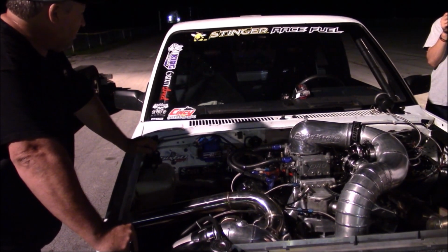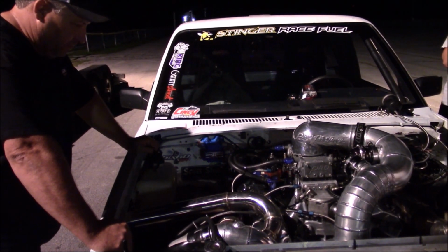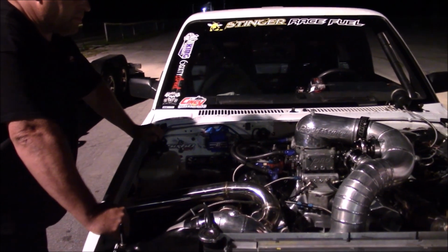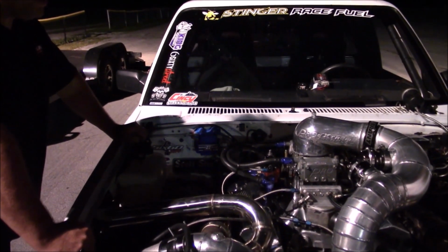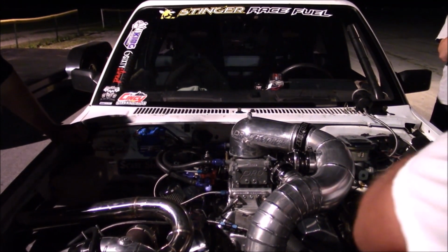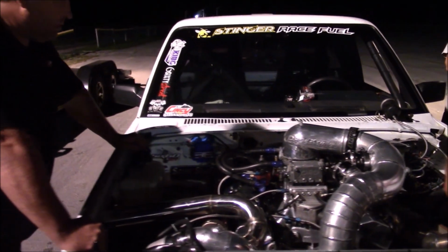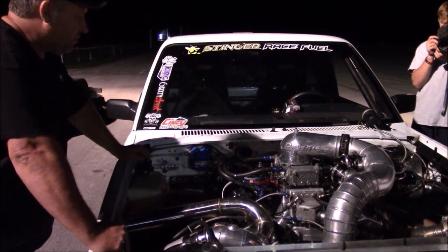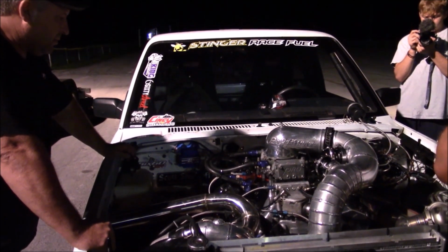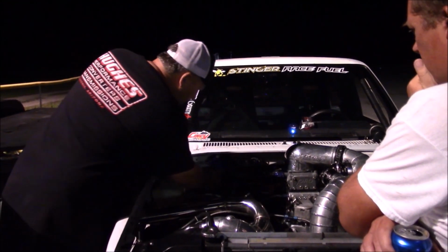It may need to have the battery ground cable to the frame back there cleaned up. Nothing else turned off? Just the engine? Yeah, just the engine shut off. Like nothing on the switch panel or anything like that. So it's not lights, not battery. That narrows down a lot of stuff. So yeah, it must come down to something with the coil or the ignition. Yeah.